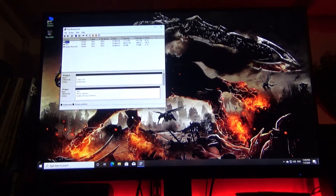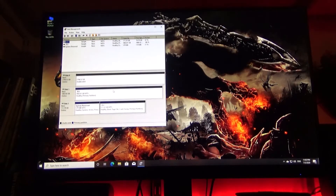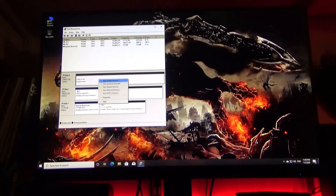Once you select that, this box is going to pop up. As you look at this new screen, you'll recognize anything with a blue strip as things that are already up and running. However, you'll also notice the drive that you installed and couldn't see, shown with a black strip. That's what we're going to take care of. You're going to right-click on the device and select New Simple Volume.